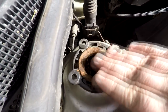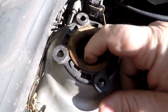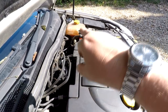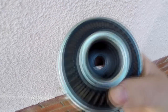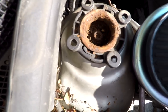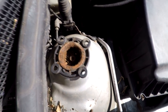This is the reason why we're changing this shock. This is often overlooked because nine times out of ten there's a cap over the top. If you take the cap off there's supposed to be a dust protector, but as you can see it's really corroded in there. That's the main bolt which holds the shock absorber in. On the other side in the previous video we had to change the shock absorber because the top mounting had corroded away. You can buy the top mountings on their own, but the nut is totally corroded away so there's a very good chance this one would go shortly as well. This top mount costs about £38 on its own, but because the nut and threads are corroded on the actual shock itself, we're going to change the whole lot, retaining the original spring as we did on the other side.